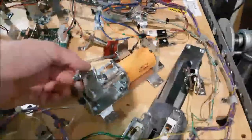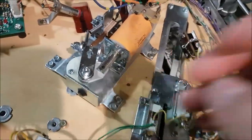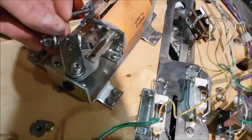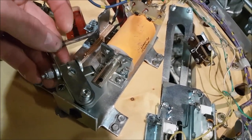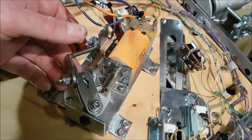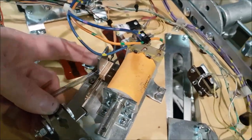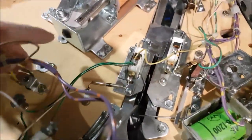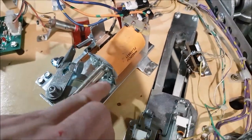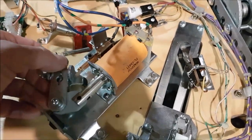The flipper rebuild kit has been taken care of — they are brand new. I need to continue my rant about how much the flipper rebuild kit sucked. It was missing the link to attach the spring, missing the screw that holds the end-of-stroke switch in place, missing the bumper cap, the nylon sleeve, and even some screws. All of this should be included in the flipper rebuild.